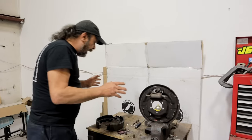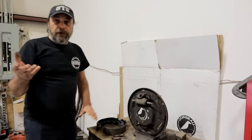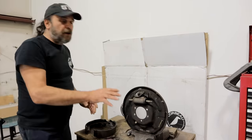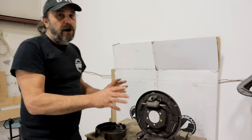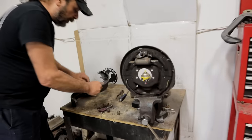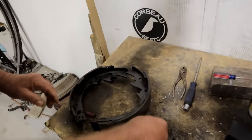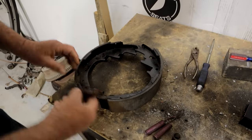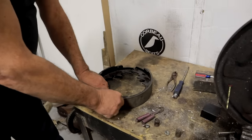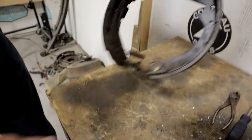There are certain aspects of assembling drum brakes that are fairly universal. What most people do - like what Wes was doing - is trying to assemble it one shoe at a time. But these things aren't designed to be serviced that way - they're designed to be partially assembled off the vehicle. You put your spring in the shoes, then drop your self adjuster in, and you get an assembly like that.